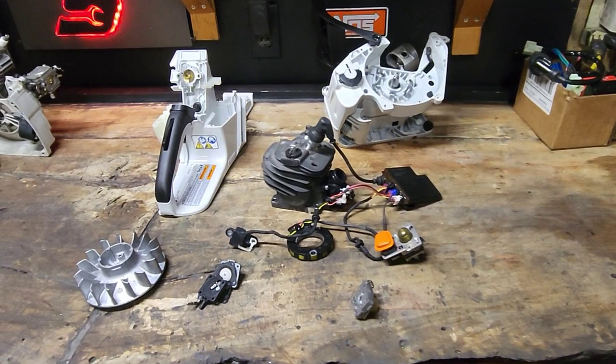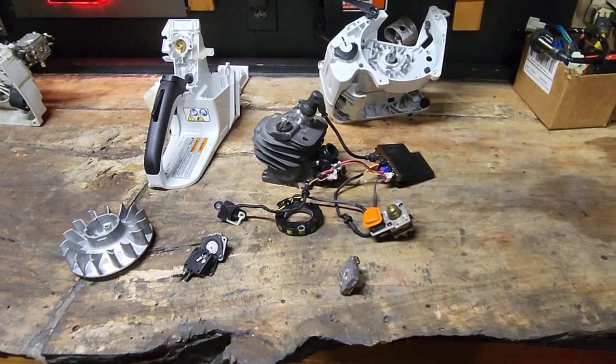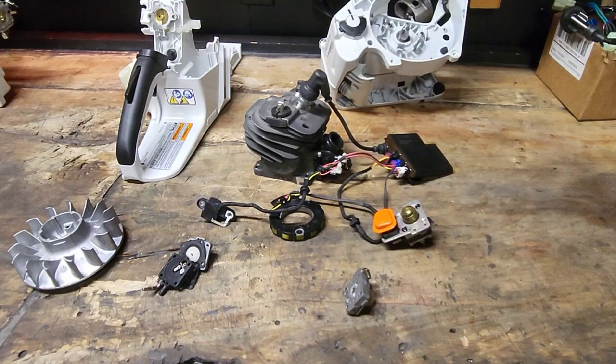I've put a 50 shot of nitrous on a 500i, and the fuel delivery was adequate. The fuel injector and the mapping system were adequate for a 50 shot of nitrous. So you're not porting a 500i to the point where you need more fuel. These people drilling out fuel injectors or orifices and all this stuff, it's not necessary.